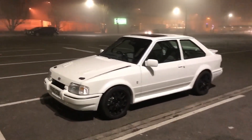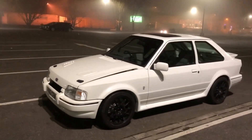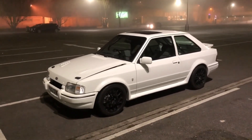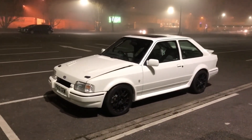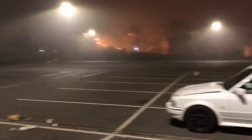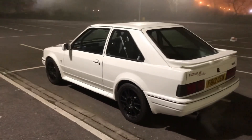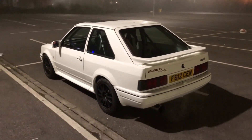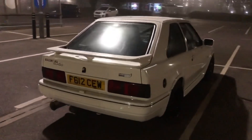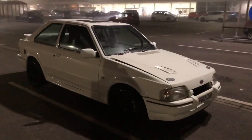First drive since the gasket's been sorted out. I turned the boost up a little bit just to get the AFRs a little bit better - it was a bit rich on boost. That cam has made a huge difference - no more misfire now, the car pulls all the way to the limiter. It chokes a little bit top end, I think it's down to the exhaust housing, so we're going to change that over. But we've got the new turbo to go on anyway, so there's no point fitting that exhaust housing on the old turbo - we're just going to put the T34 straight on. She pulls hard now, only running low boost. Starting her up on a freezing cold night so a lot of condensation about, very foggy, but great for air charge temperatures. Exhaust sounds perfect, idle's all set, fueling's set - this car should have sounded like this from the start. It's very difficult to diagnose cam issues especially when the car idles and drives how it does - it just seems like a spark issue. For a solid lifter engine you can hear how quiet it is, though you'll always get a little rattle from the rocker arms.